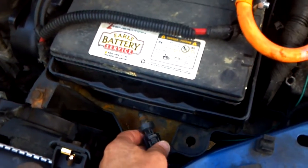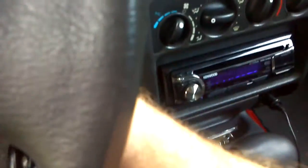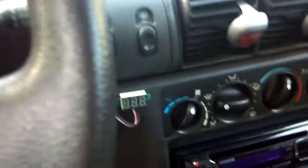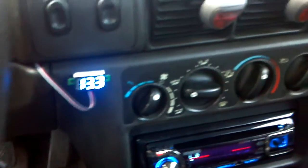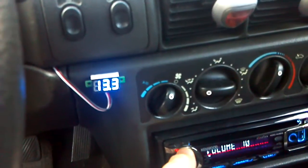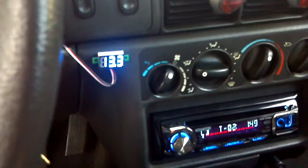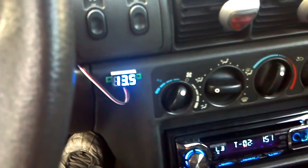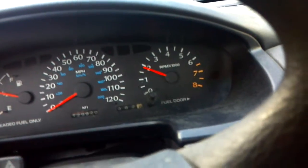So this is what I did, but I'll show you first. You see the sensor's plugged in and everything. I'll start my car up and show you my voltage. I'm at like 13.3 volts at idle — 13.3. I constantly will have to hold my gas. I'm at 13.6 at 2,000 RPM.